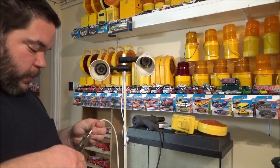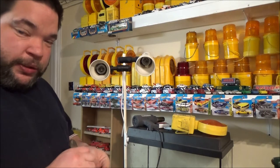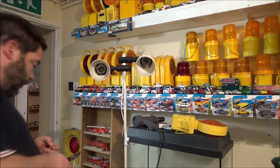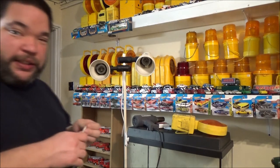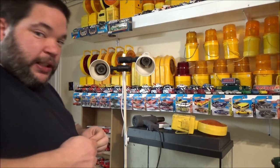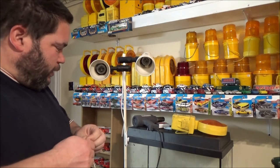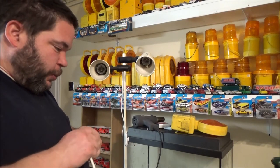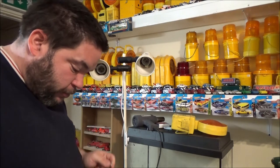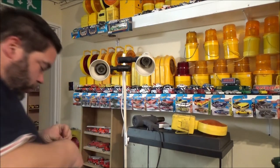That is near enough the same length. I'm just going to cut that end off, go down to this end, and snip through that. I thought a nice new connector would look nice as I'm replacing the faulty switches anyway. I have taken one of the old switches apart, and the contacts had basically just gummed up — there's a bit of dirt and filth on them. I've got one apart but they're not easy to put back together. I've cleaned up the terminals, so if I put them back together I could use them, but it's just being an absolute pain. How they do it in factories, I don't know.